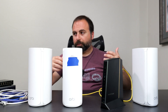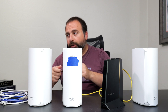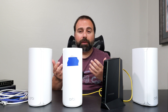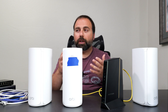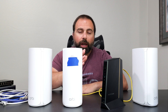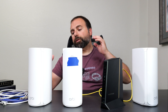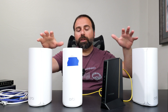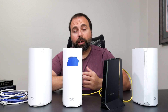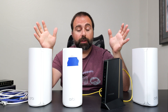You may need to relocate the Orbi satellites. Once set up you can unplug one and take it to another room if the distance wasn't ideal. The optimal distance is typically around 30 to 50 feet away, but it depends on how thick your walls are. In my wireless backhaul testing it's typically around 35 to 40 feet with a couple of walls in between and I usually get pretty good signal that way. Once it reconnects, devices start connecting to it if they're close enough.